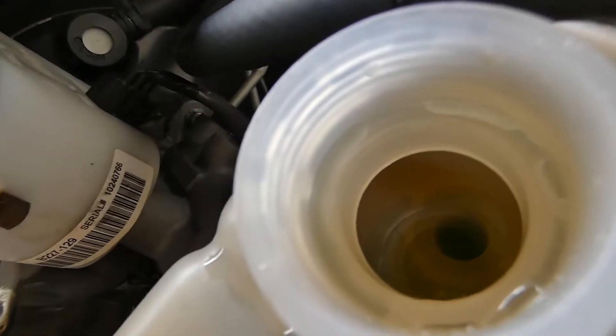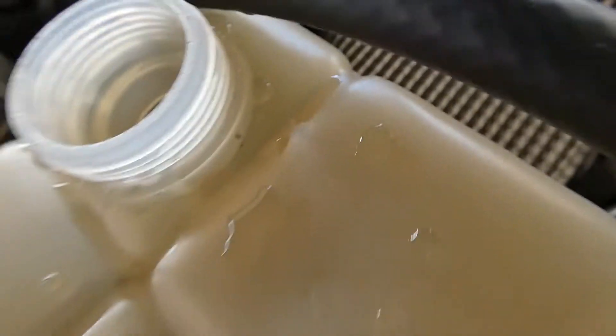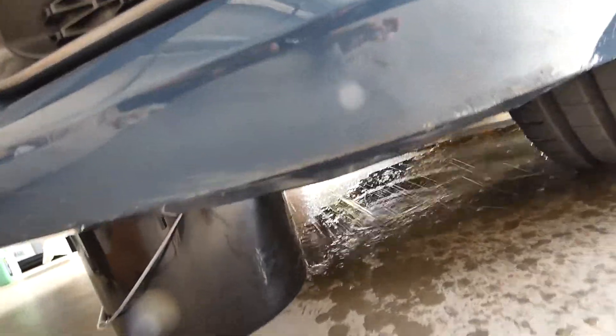We're all shut off now. Got up to temperature — as you can see, a lot more green in there. That's why it's so important to get it up to operating temperature and also open up your heater core, because all that coolant was obviously still trapped in there and if you didn't do that, you wouldn't have got it out. Now we come back under the car and slowly undo the tap. Obviously be careful when doing this because the coolant can be hot.